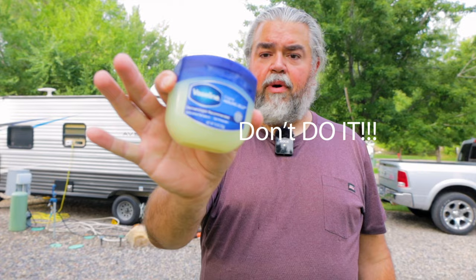I had a little pan down there — a black tub with yellow handles that I use for black tank accessories — so that one sat down there and caught any drips last night, and I poured them into an empty sewer hole this morning. I went to the store and bought some Vaseline, took it all apart, and could see where the gasket had gotten kind of wrinkled in there — that's probably where the leak was occurring. I cleaned it all up, dried it completely, then coated each seal with Vaseline and put them on each end of the sewer pipes. The Vaseline helped it stay on there and gave it a little lubrication as it was going on.